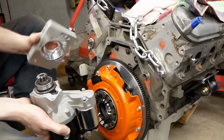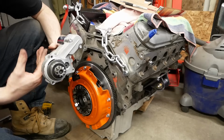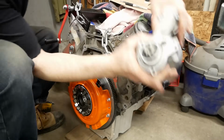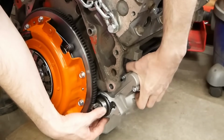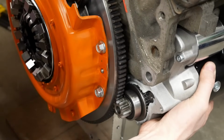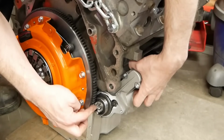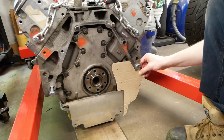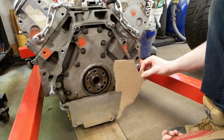So this is modifiable. You can now get an idea of how, with this up next to the V of the engine block, it's kicked that gear off to the side. So the plan is that we can make enough room down in this real estate to actually engage right there. There's a little boss on the side of the engine that's going to need to come off, but we should be in the right vicinity to get that little guy going. After fiddling around with some cardboard templates for probably too long, we could get on with cutting some steel plate for the actual mounting bracket.